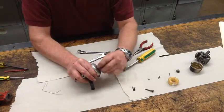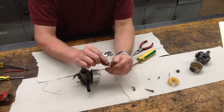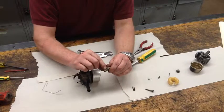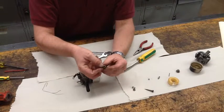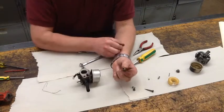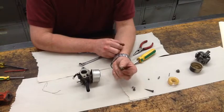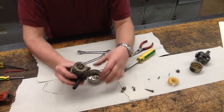This one should have a fiber washer between. You can see here that we have a larger hole, and then up above in this open area there should be some real fine, small holes. I need to make sure that those are clear and that I can actually blow air through them. When we open this up, it's basically the same.